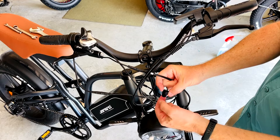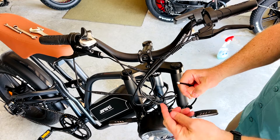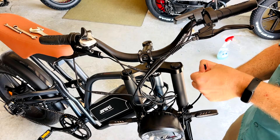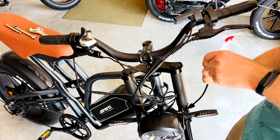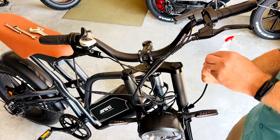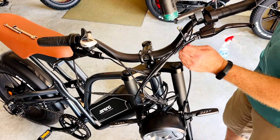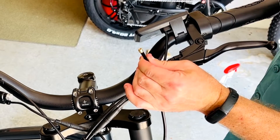It comes with three parts. You have this rubber cap — put that on first, it slides down. Then take this black nut and remove the little cap. Keep this vertical, slide that black nut on, then slide this olive on. This is a little brass olive — that's what gets swaged into the brake area. Push that on right where the tip is. I had to use a little mallet to pound it on softly and gently, not to damage the edge of the olive. Now you can see it's flush with the end.